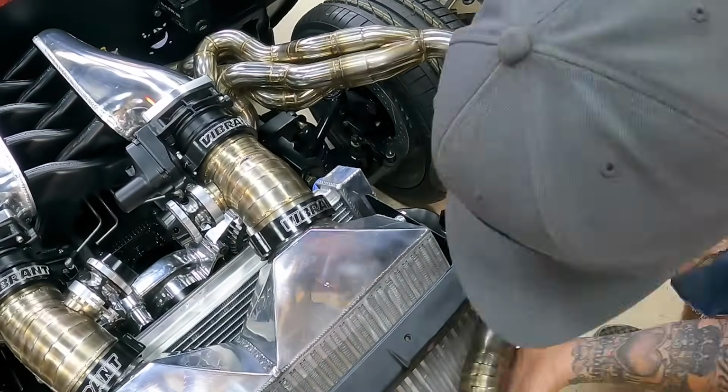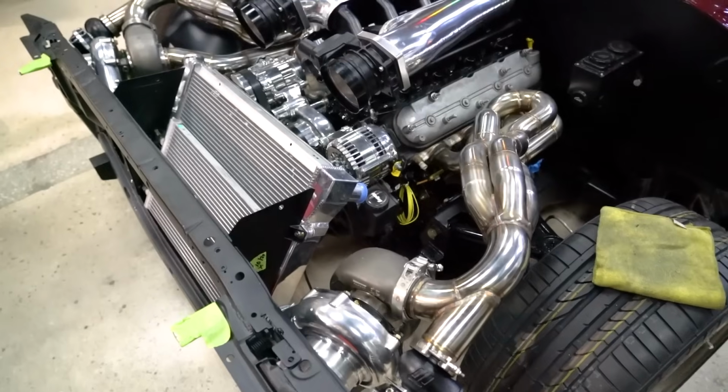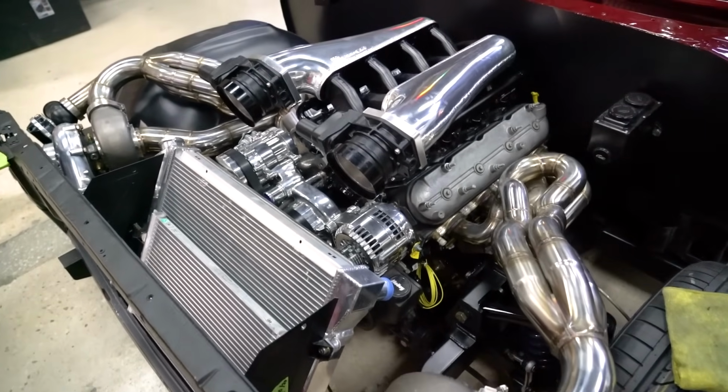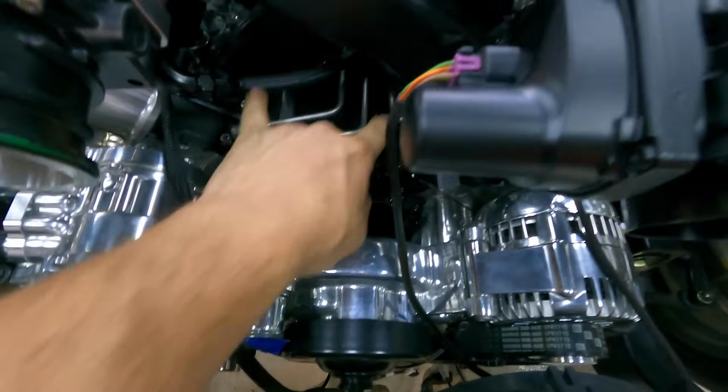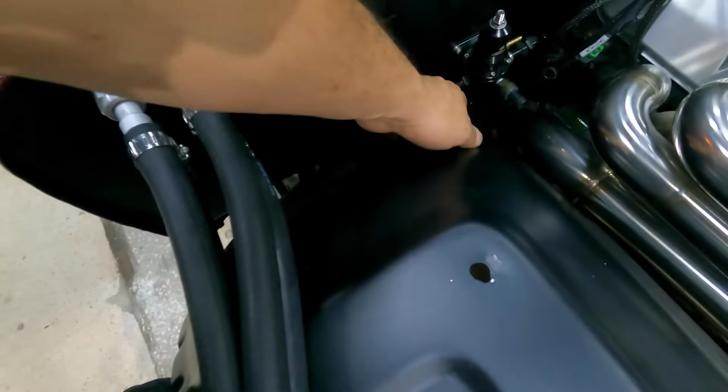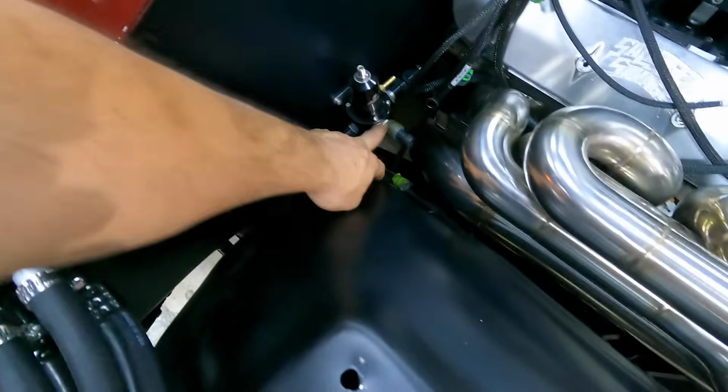We've been steadily pushing, trying to get everything in the engine bay packed back in here after all the paint work. We have gone and started doing plumbing as well. If you could tell, we've got some fuel lines under our fuel rail. These are teed from a junction here in the middle from our dash 10 line. Our regulator is mounted down here with our pressure sensor.